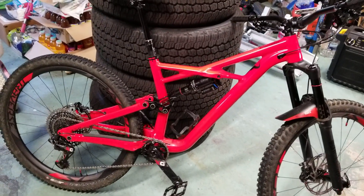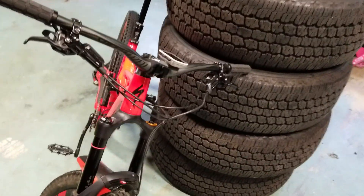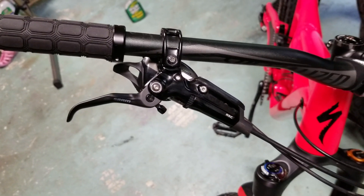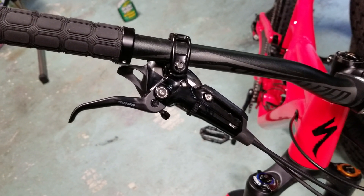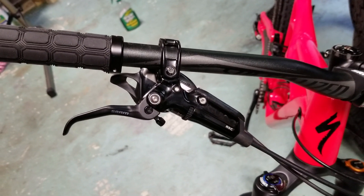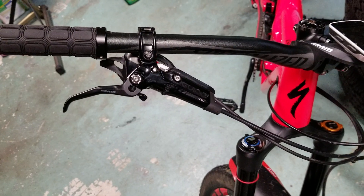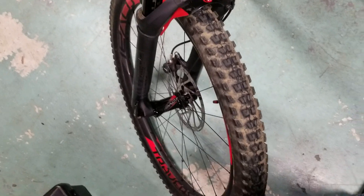What I have modified on this bike: first, some things I modified right off the bat when I first bought the bike. It came with Guide R brake levers and I wanted the extra stopping power and modulation, so I immediately asked my bike shop to swap them out and put the RSCs in there — and those are wicked nice. The S stands for swing link, which is like a cam built into the lever that effectively amplifies the leverage and stopping power experienced down at the disc.